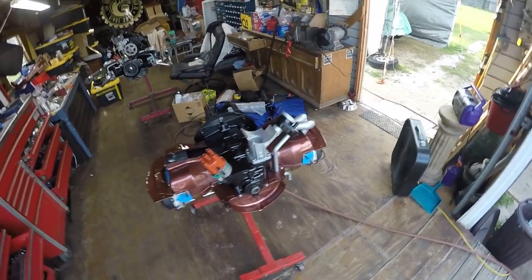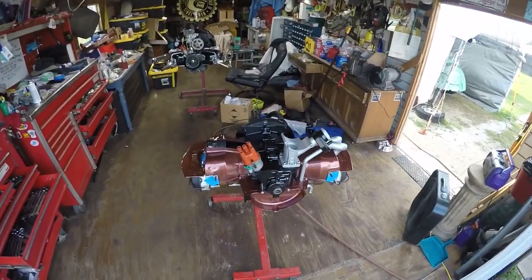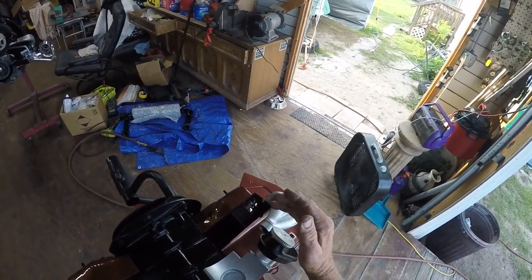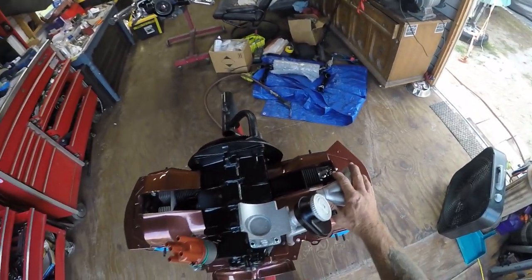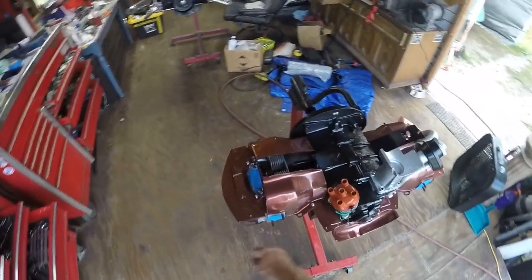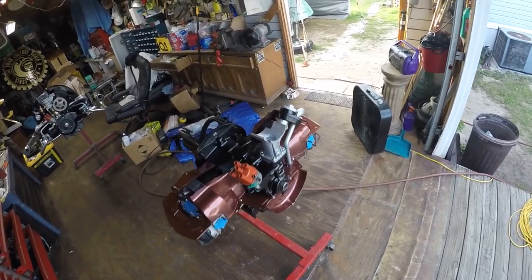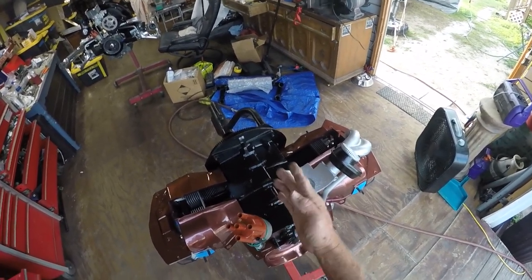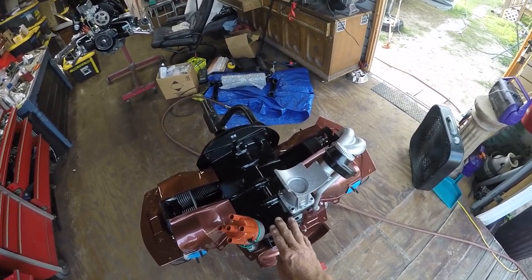Let me get a little further on the peach red convertible Super Beetle. I'm getting ready for the intake — I know all about trimming the manifold ends from the dune buggy build. This is getting a 38-millimeter two-barrel carburetor, so it's always something. The bracket that stabilizes and secures the manifold for the carburetor mounts to the back bolt of the fuel pump.